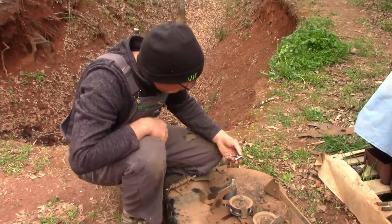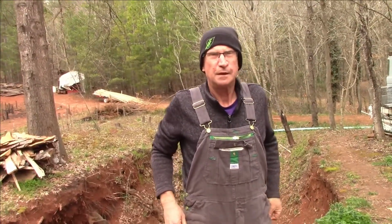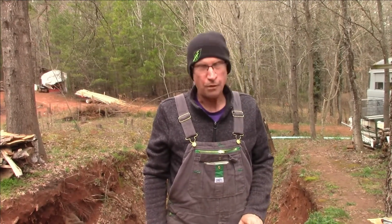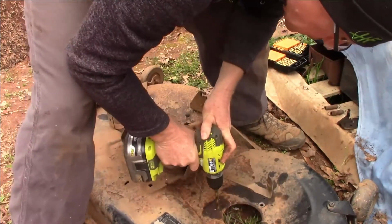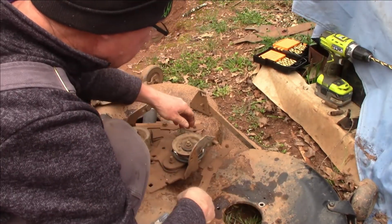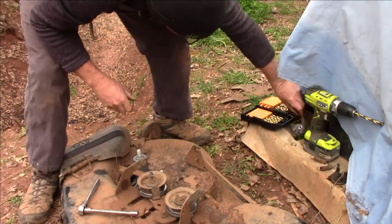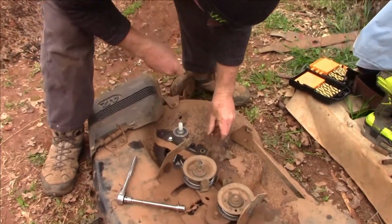I guess what you got to do is make it kind of work. So it fit the model and everything, but that was one thing you always got to worry about. You got to look at it, it could be off just that little hair. So I think if I just widen out one of the holes just a hair, it should work out just great. So I just used a drill bit that was about 2 sizes bigger to go all the way around. Don't want to forget putting our little spring holder in there that we almost did.